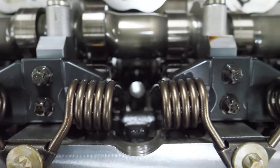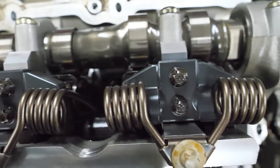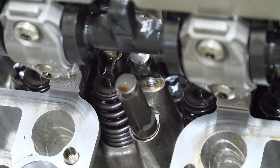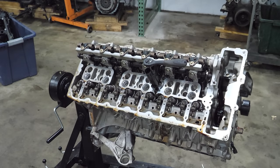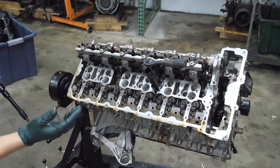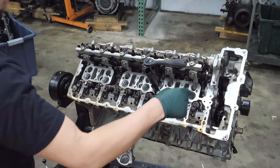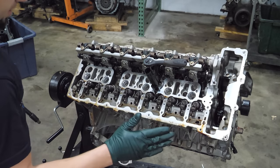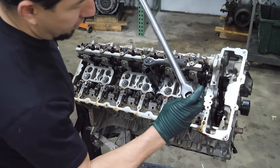I need to remove that stop and move the gear out of the way, then the rest are pretty much a straight shot. We'll remove the electronic stop very carefully. Now it's time to get the big head bolts out. One major difference: the S55 has uniform head bolt size, whereas the N55s and N20s have smaller T55 head bolts on the corners and larger T60s in the center. The S55 is only T60s — which is good because I don't have to switch tools so often, but bad because it's a much tighter fit in certain areas.